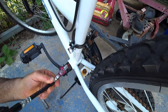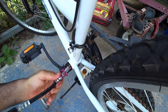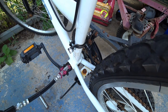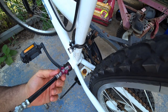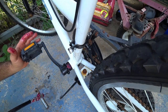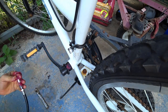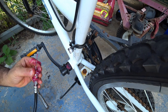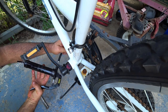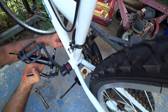I've got the grease gun needle on the end of the grease gun — it's basically got a little grease fitting that goes right in just like a regular grease fitting. I'll put the needle in here and start pumping grease. The type of grease I'm using by the way is the red Lucas grease — you can buy it at Walmart. I could try to get a little in the back here, but you turn this so the needle is open to this side. I'm not sure I'm really going to get any in here but I'll try.